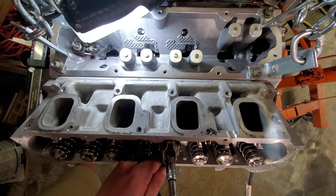After pulling the push rod out, with some light I can see we're at four turns. I'll take the digital caliper to confirm — keeping hands steady — and we're at 8.005 inches. That is the length of the push rod. The tool is really pretty accurate, so most people can get away with just using the lines. Four turns out at 0.050 per turn: two turns is 7.9, four turns is 8.0 — push rod length at zero lash is 8 inches.